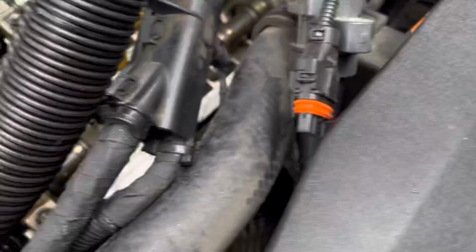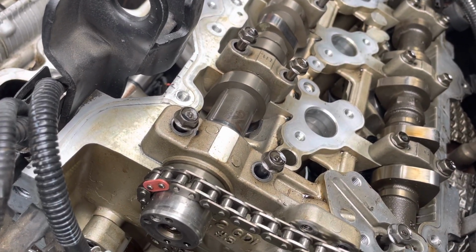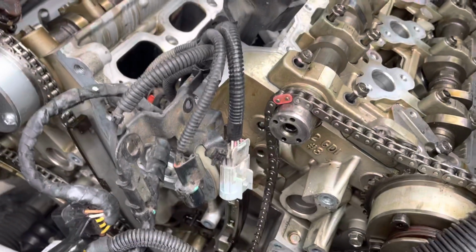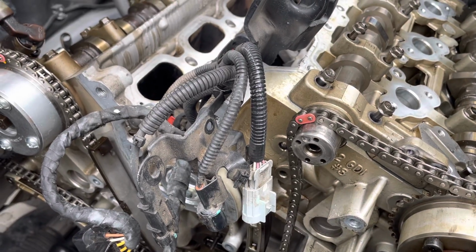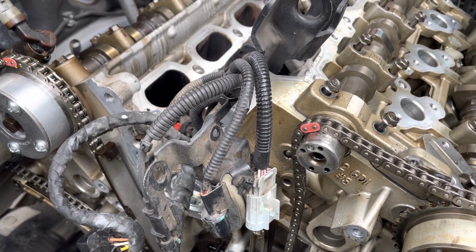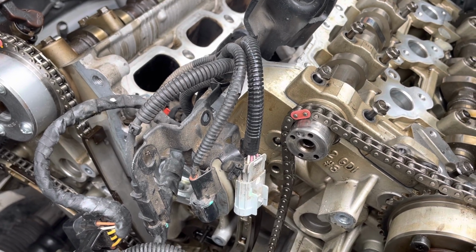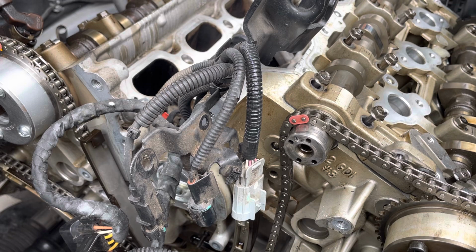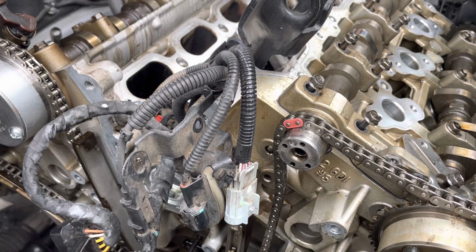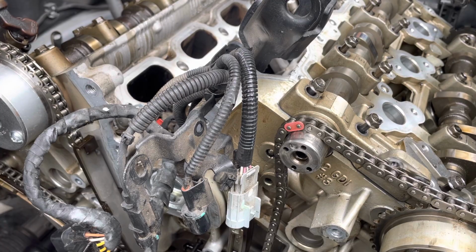At any rate, had to order a new camshaft, a couple $100, well, $250, I guess. I was quoted about $10,000 to do the repair, so the car's worth substantially less than that. So I thought, well, shoot, I'm a fool, I can do this. So here I am. So far, so good. I found the actual problem, both problems, the chain rattling, which was pretty much a gimme, and then the P0018 code would be that pin that is broken off or has migrated into the camshaft.